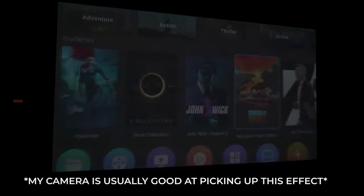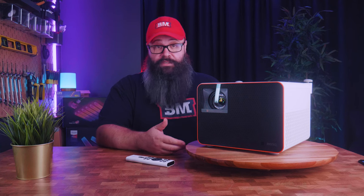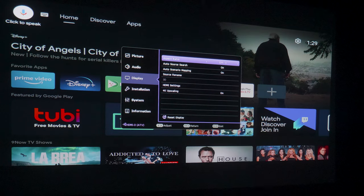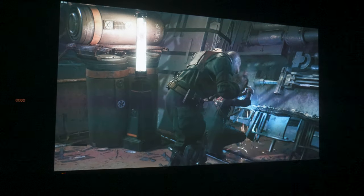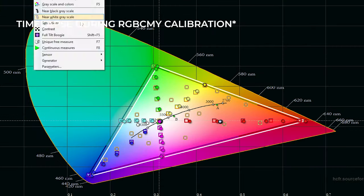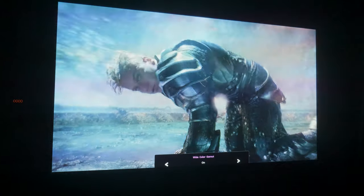The projector is also pretty quiet, which is another benefit of the LED light source. The projection system uses a DLP chip, and I didn't notice any rainbow effect — though to be honest I don't think I've ever noticed it on any projector I've reviewed, as my eyes just aren't susceptible to it. There is a native 16:9 aspect ratio, though it can also do 2.40:1 and 4:3. The native resolution is 4K UHD at 3840×2160. With gaming mode enabled we get 4K at 60Hz with 6ms response time, and at 1080p with 240Hz refresh rate you get 8ms — so this projector is an absolute beast for gaming. It supports up to 100% of the DCI-P3 color space, allowing you to extend HDR mode using a mechanical filter that snaps into place.